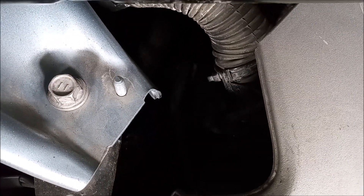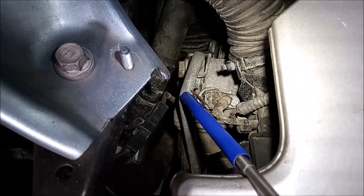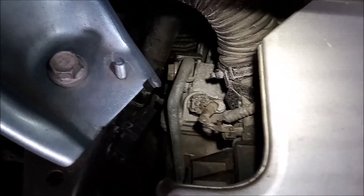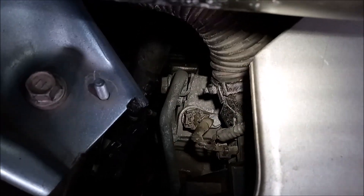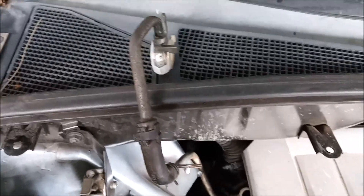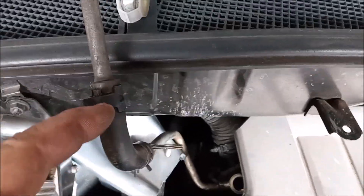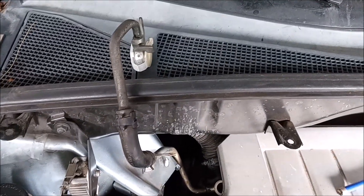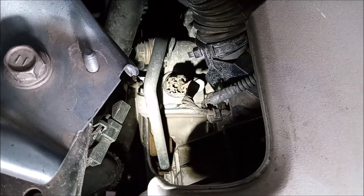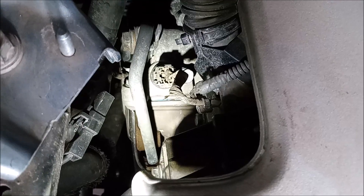Now I'm going to shine a light down here. Looking straight down here, this is the VVT line — this tube right here is the VVT line — and you can tell just by looking that this VVT line is already an all-metal line. The VVT line is oriented on the engine exactly like this, and if it had a rubber segment, that would be visible when we look down inside. See, there is no rubber elbow on this one.